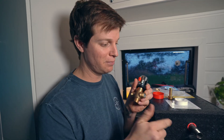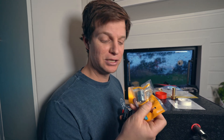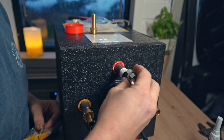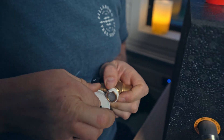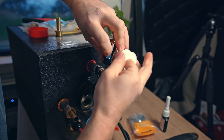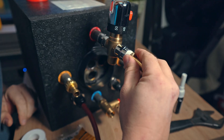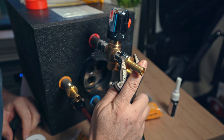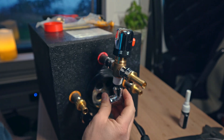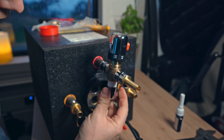We have our mixer and our hose attachments, but both are male so they won't fit directly. We have a female half inch coupling that goes on there which allows us to screw on — one for hot water in, one for cold water in, and one for hot water out. On all the fittings on the hot water system we are using thread tape and then adding a female to female adapter. On the front side of the mixer we're adding a hose adapter so our hose can go straight in for the cold water. On the bottom side we added thread tape and an angle piece because the duct for the diesel heater below was in the way.